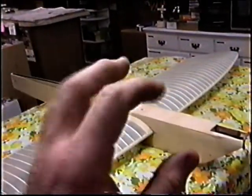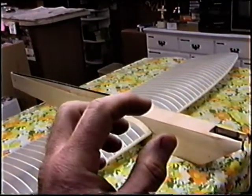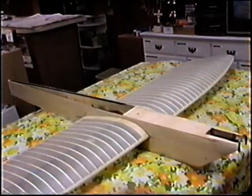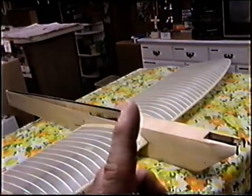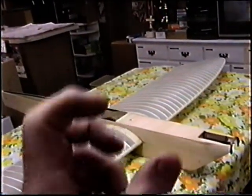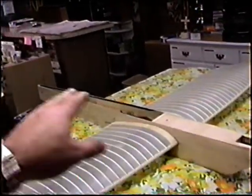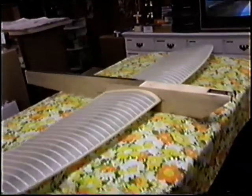So before I go on to painting this, the first thing I want to do is do the little test parts. Then I'm going to come back in the house. The reason for that is, while the test parts are drying, I can see if they're going to fog up from humidity and if I'm going to have to add retarder. That'll give me roughly a half hour to back mask this off, and then get outside and spray this.